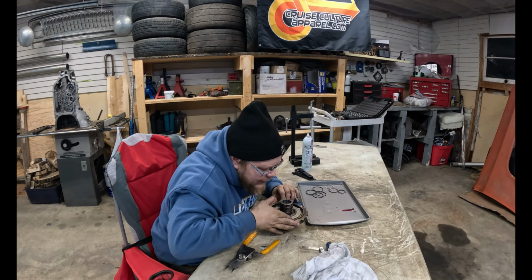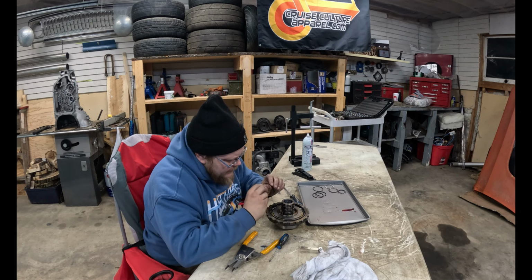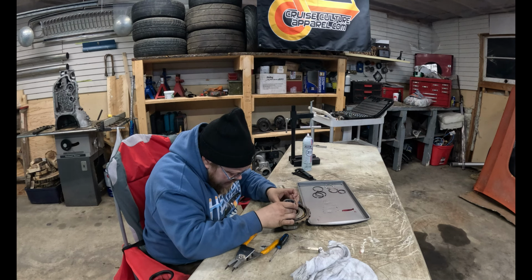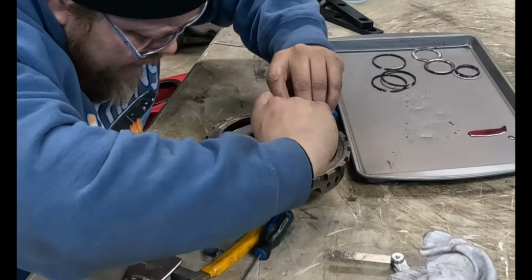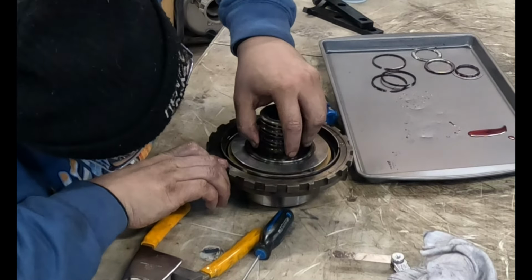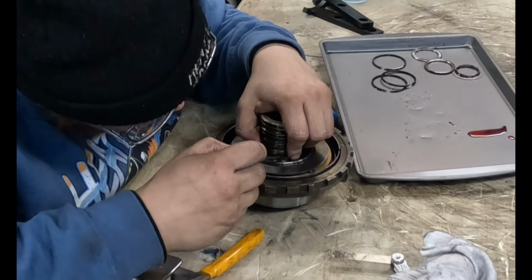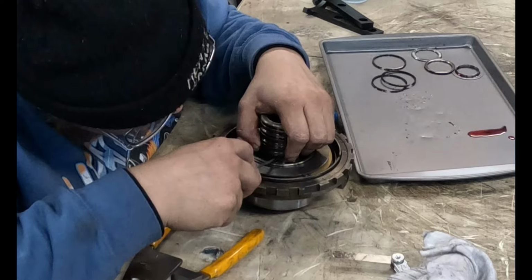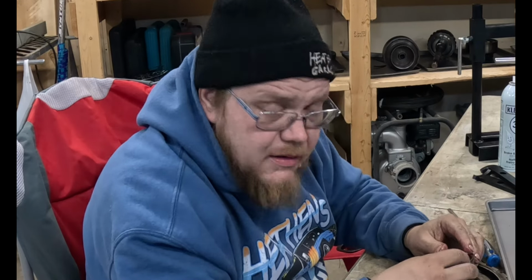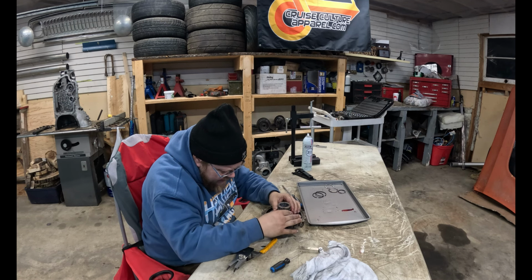Yeah, I got it. Now we put the piston rings back on. When you put these on, they have to snap together, right? So you have to pull them out and push them together. I probably can't even show you adequately, but it's obvious what you have to do, that doesn't make it easier. I don't think there's an up and down to them, but results may vary. Consult your book or guy or whatever.